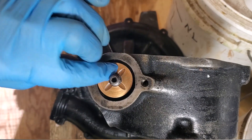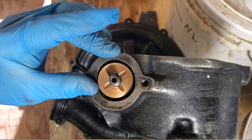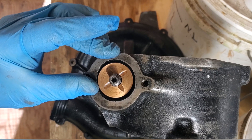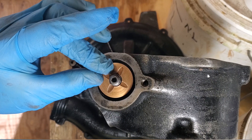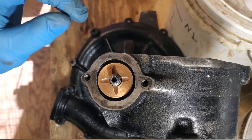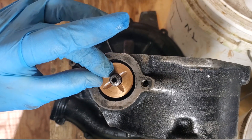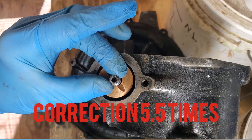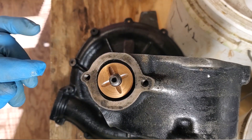One of the things that happens is these shafts often get a groove worn into them. Oil filters were optional back in the 1930s, and as a consequence a lot of cars were run without clean oil. Without clean oil this floating washer will wear a groove into a steel shaft more than it'll wear itself out, getting off-center and wearing a groove at six times crankshaft speed. So sleeving the bottoms of these shafts is pretty common.